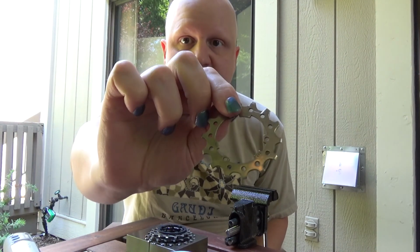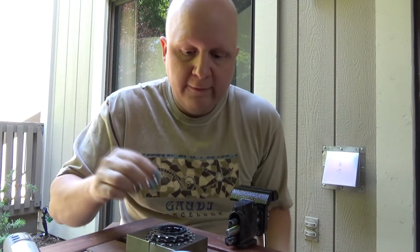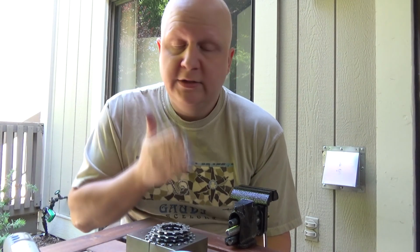And you say, well, how can I find pins? What size even is the hole in here, right? Who knows? What I did was the slightly simple thing. I said, hey, I got drill bits in 64th increments. Let's just see which drill bit fits in here, and then I know what size of pin I need.